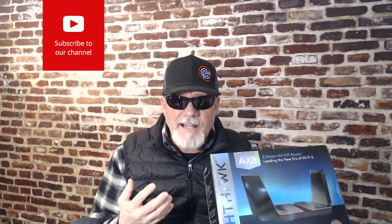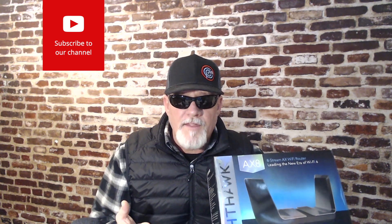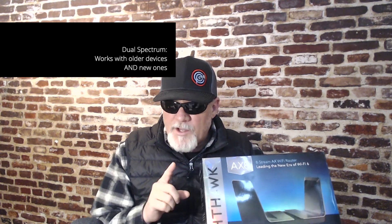You need to do your homework depending on what's going on in your household or business. This is for my podcasting studio, and I podcast in the middle of an area that's highly congested with Wi-Fi signals. On my network list there are probably 10 networks showing up with full bars, all on similar channels, which creates a lot of noise and interference. Wi-Fi signals begin to compete against each other, so it's important to select a device that is dual-spectrum — 2.4 GHz and 5.0 GHz simultaneous — because your quality of service will go up.